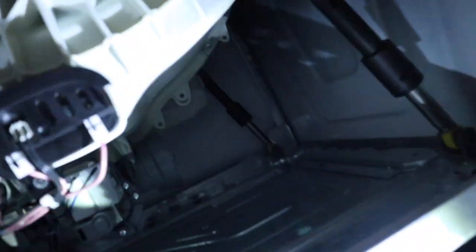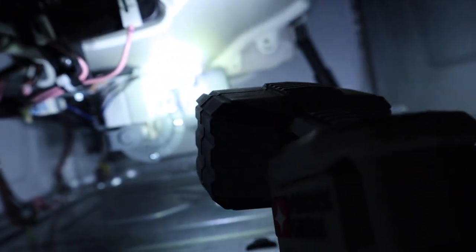I just want to check the filter, which is located right there at the bottom. A lot of people say that most washers you can access the filter from the front, but on this one you have to take off the back, which kind of sucks. We have a new dog since I made the last video, and there's a lot more dog hair in the filter. I also checked the drainage hose — I did both of these things in the other video, so please check that out.